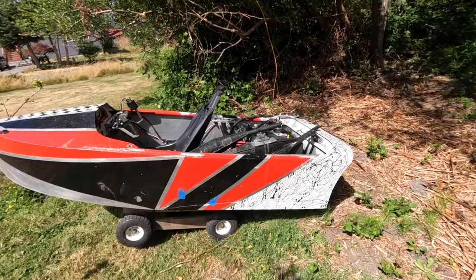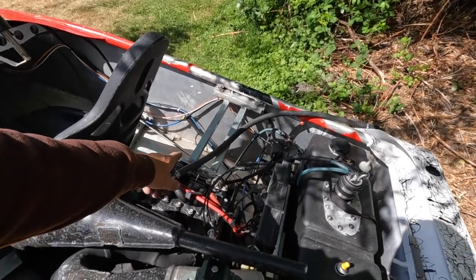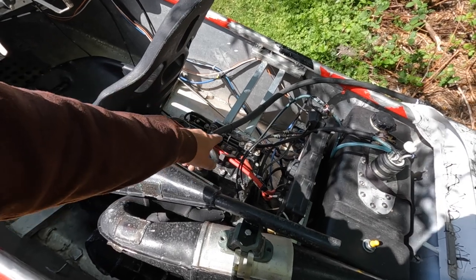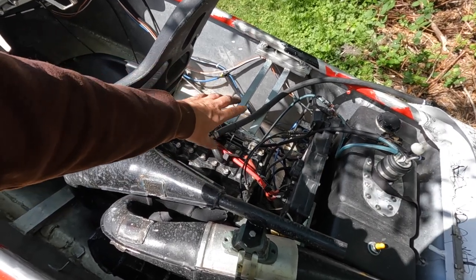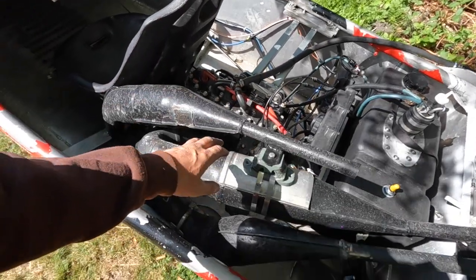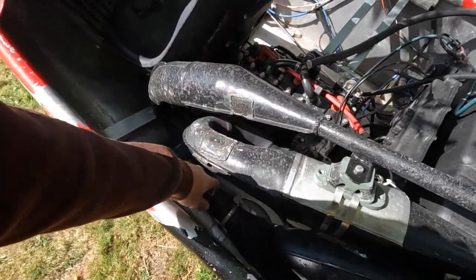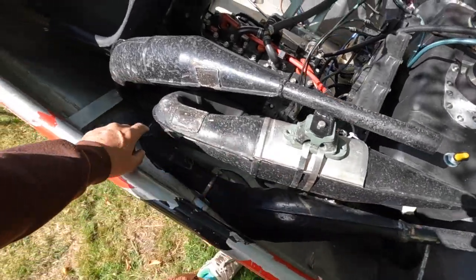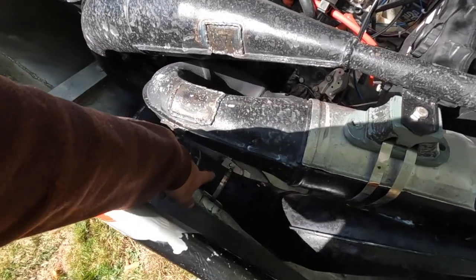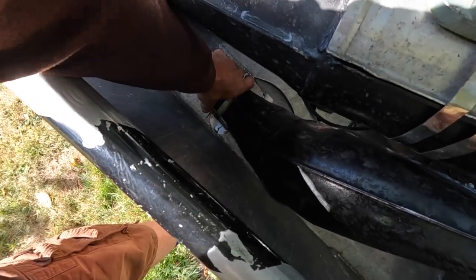All right, folks, we have been hard at work building some supports. Came up with this idea last night, basically trying to dampen out some of the vibrations of the engine. So we built a support for the top of it, and hopefully that will stop the engine from rocking a bit and mean that we have to have a little less support on the exhaust, or hopefully it'll mute out some of the vibrations. We've also welded this back together, welded down around the header there where it broke, and came up with this idea for a midpoint brace on the pipe.